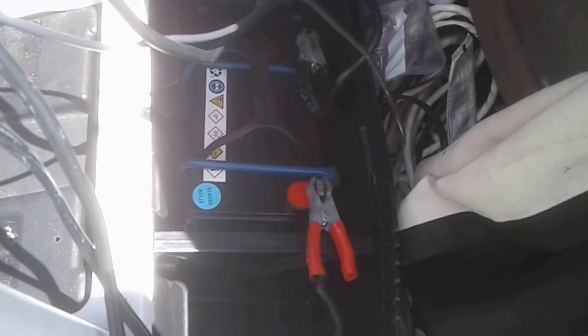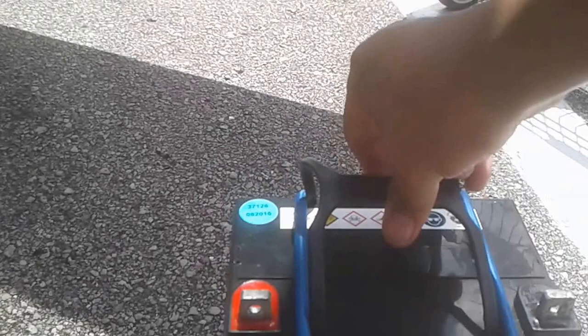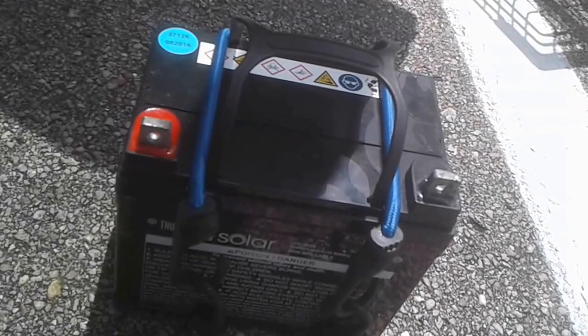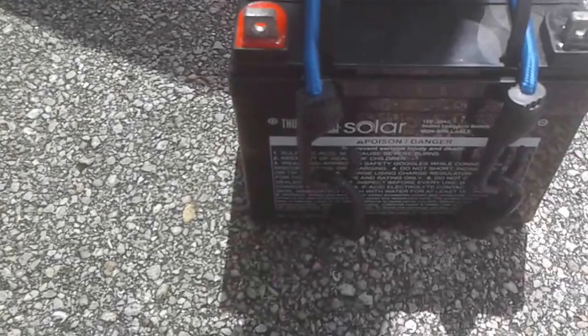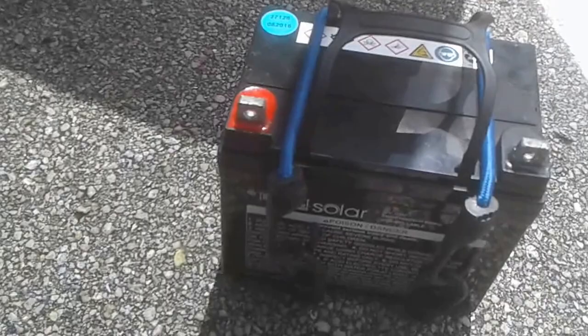Here's the current system. It's got the AGM battery right here that I bought from Harbor Freight — it's a 35 amp hour absorbed glass mat technology battery that's meant for solar and RV-type use. It's a 12 volt, 35 amp hour sealed lead acid battery, non-spillable. The problem is it didn't last very long. I don't think it even holds 35 amp hours now — it's holding more like about seven or eight, and it's only been about a year. So I wouldn't recommend getting this — I guess they call it the Thunderbolt Magnum solar battery from Harbor Freight. Don't do it.